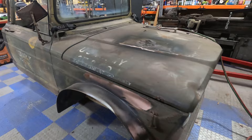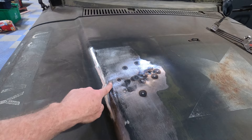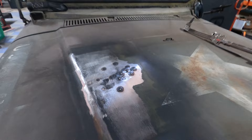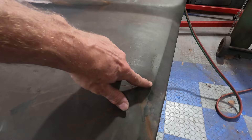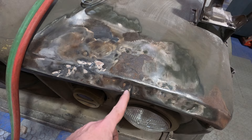Here's just the walk-around of it. I started doing a few things - there was really bad oil canning in here and I started doing a little bit of shrinking in areas to bring that back in. They had filled this - there's a lot of body filler here. This was probably almost a half inch deep in here. It looked okay visually but it was just popping all over the place and I just didn't want that. There's a big dent here too.